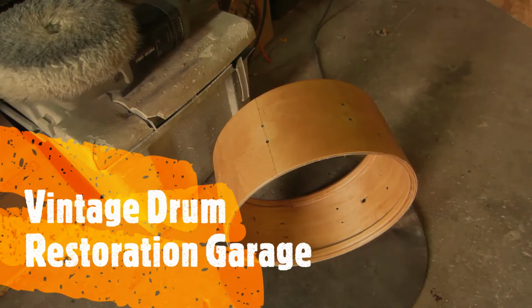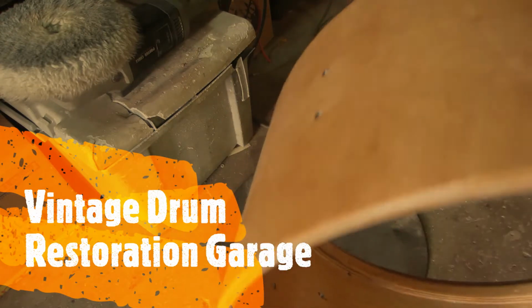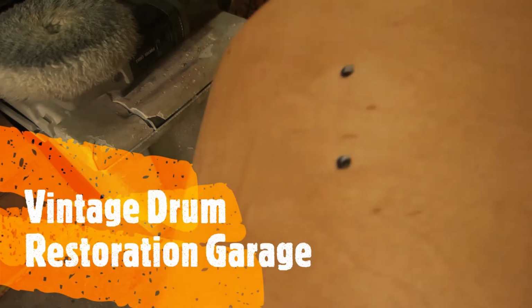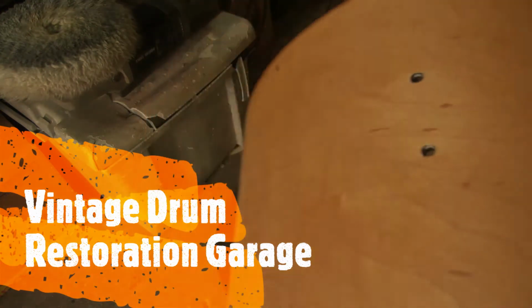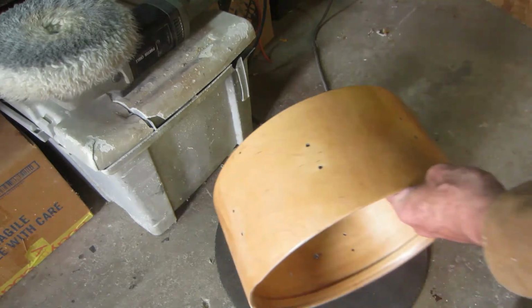Okay, now we're going to take this shell and buff it out. Now that we've wet sanded it down and gotten all the orange peel off, you can see there's no shine to it. We don't want to see any areas of shine. We want it to be all flat. This part, we'll start right here at the line and work our way.